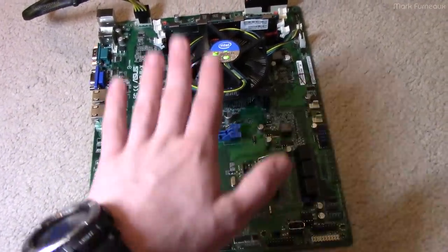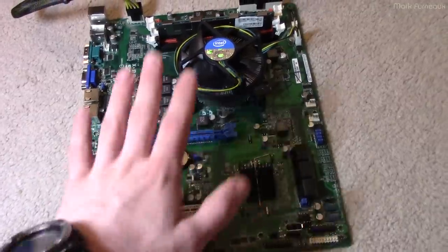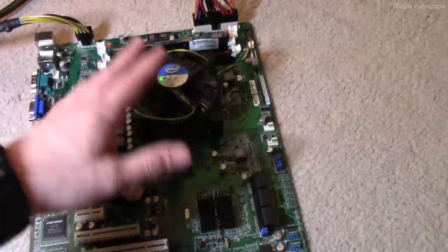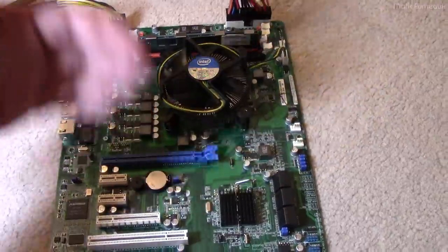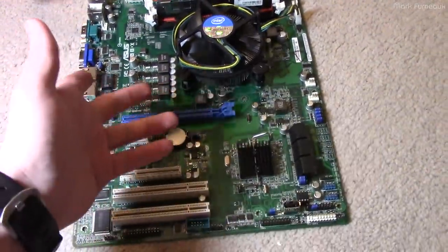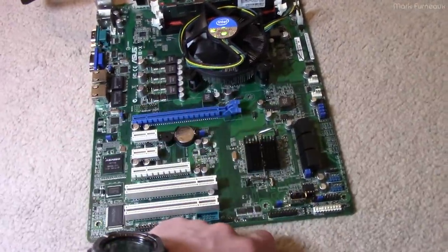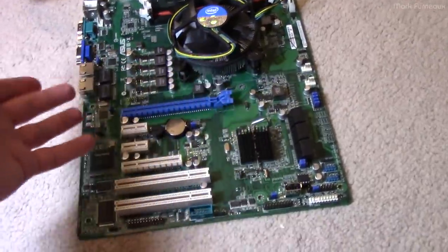Let's start with the diagnosis — it doesn't work. The first thing I did was check the memory. It had four DIMMs in it, so I took out all but one DIMM and tried it again — that made no change. Then I swapped out that one DIMM to verify I didn't have problems in the lower 64K of RAM, which will stop it from POSTing — that made no difference. Then I cleared the CMOS — there's a jumper for that — that made no difference. Then I removed the battery completely for a hard reset, waited a minute, put it back in and tried again — that made no difference. I checked the battery voltage — that was fine.